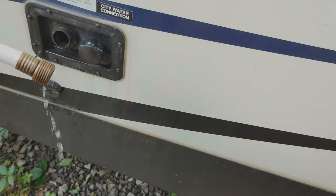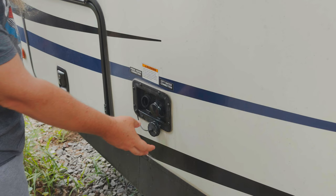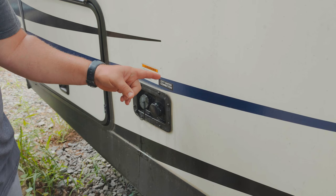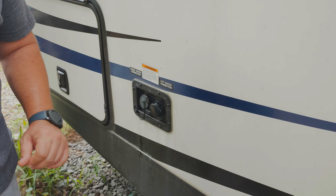So you can see with the water buffalo - I've been taking the hose, this is what I use to fill, which right now is done filling. If we listen, the pump still cycles. It's short cycles. I'm scratching my head because we have looked throughout the entire trailer and I do not see any leaks whatsoever, but it's still short cycling.